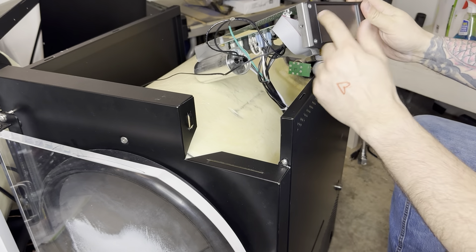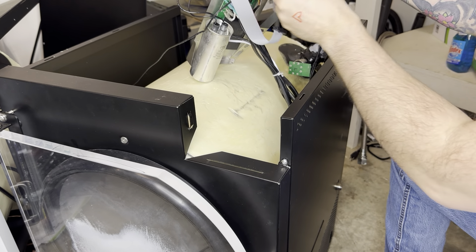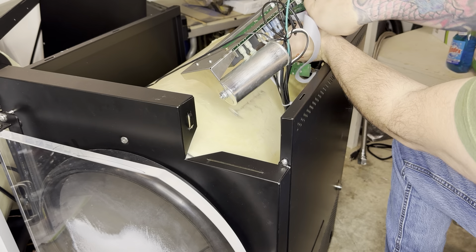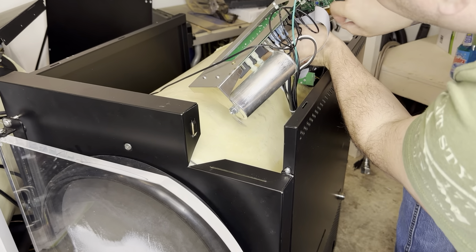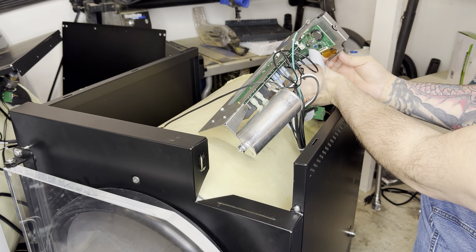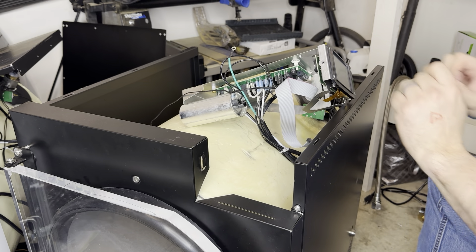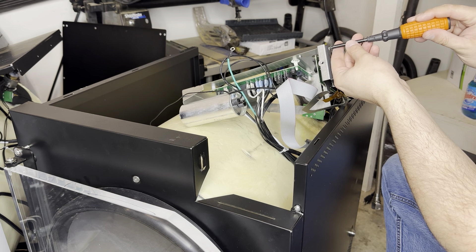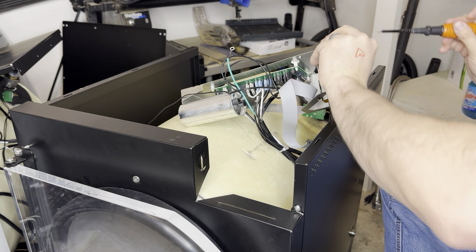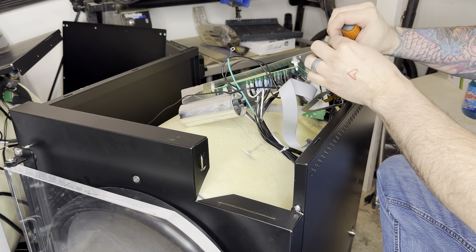You'll see the screen has four screws on the front. After doing that, take off the gray ribbon in the back that's connecting it. If you look in the back of your CPU or USB port, you'll see there are wires back here. Flip the little switch down with your fingernail and it will let you pull out the ribbon cable. Next we're going to take off the screen. At the end of the day, we have a replacement — we believe it's broken anyway.